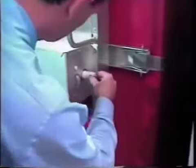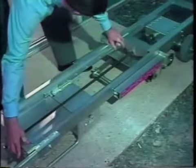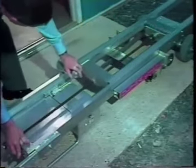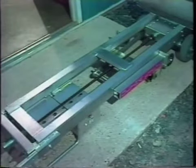Anytime the UltraLift is stored in the stockroom, it should be hooked up to the battery charger. It's not necessary to remove the battery box cover to charge the battery. Keep the drive screw and ball nut lubricated with Super Lube or Tri-Flow to reduce friction in the moving parts. Never use WD-40 or grease.